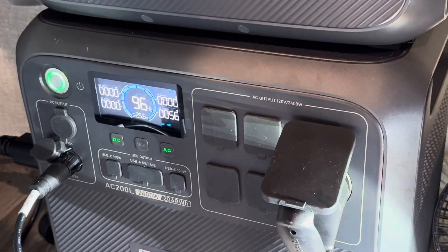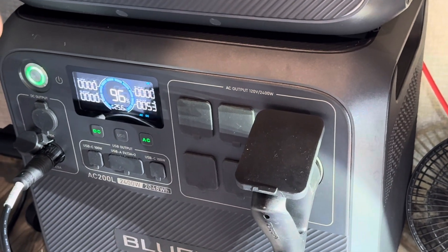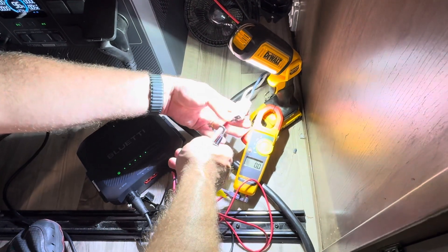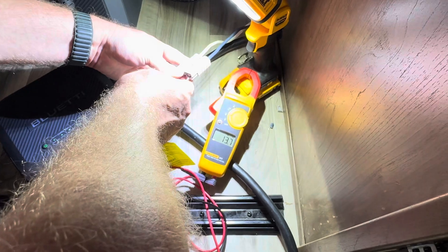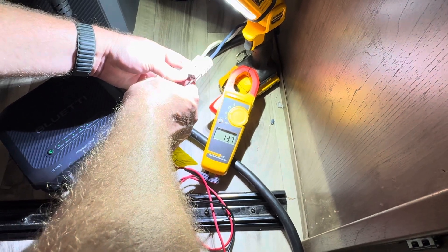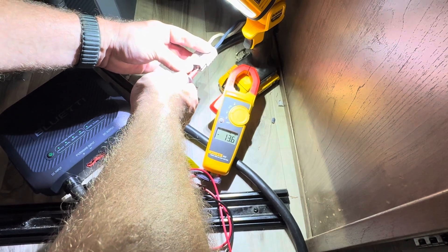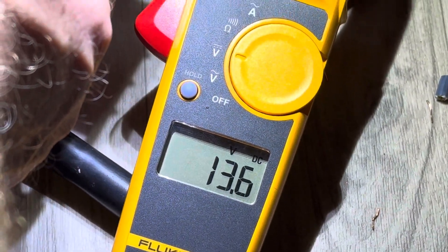I have 60 watts — that's AC output going to my DC converter for the RV, so it's not an excessive load that would cause the D40 to trip. The other thing I want to show is the polarity. I have white and blue — white is my red and blue is my black. I have 13.7 volts DC being output by the trailer right now. If I reverse those, I get negative 13.6, so the correct polarity is white to red and blue to black.